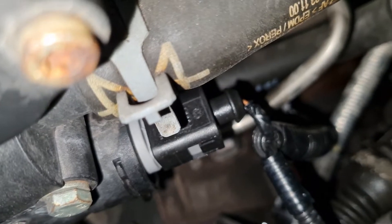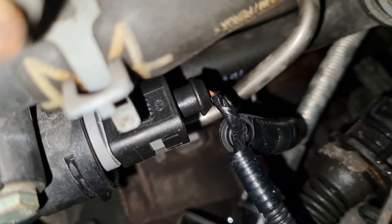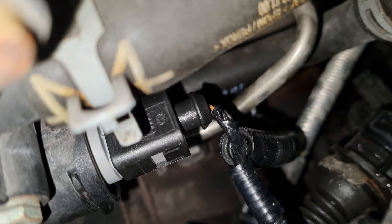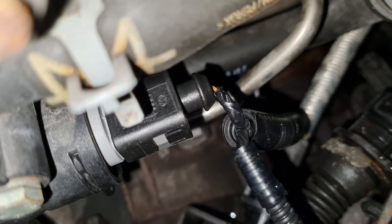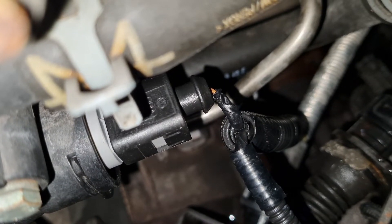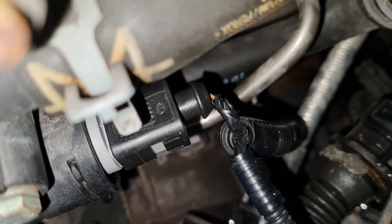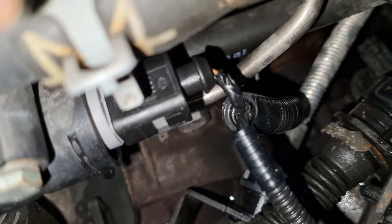It's done. Trying to get a closer look so you can actually see. It's there - wired into the back of the new sensor. Moving from the middle where the cable is to the left, the black bit is your sensor, then you've got the sort of grey bit - that's the end of the plastic housing of the sensor - and then to the left of that you can just see that U-shaped clip that holds it in place. Make sure you've pushed that new sensor all the way home so that the grey bit meets the black bit. I actually dropped the new clip down there somewhere, so I had to use the old one.